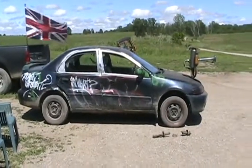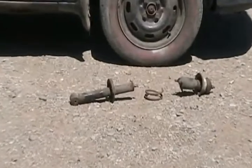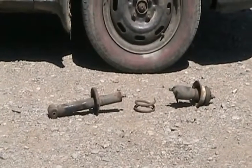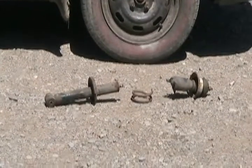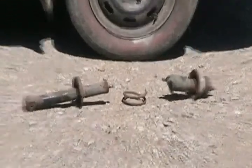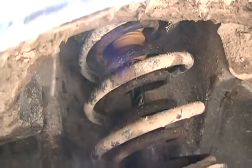Great for high-speed off-roading. Notice how high that thing sits now in the front end? One more final mod I did to save the aluminum oil pan from destruction hitting all the rocks on my farm: I got a pair of rear VW struts, cut them in half, took the springs out, took a little piece out of the spring, and double-sprung my front struts.